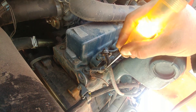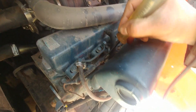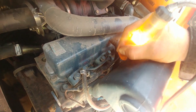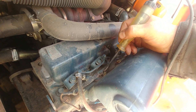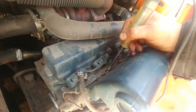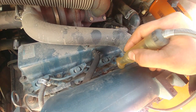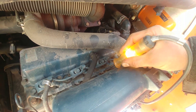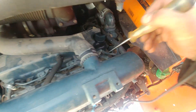A bright glowing yellow light means electricity can flow and the glow plug is good. This one is good — not open. Going to the second one — good too. If you touch it and there's no light or the light is really dim, that means increased resistance on the glow plug. You can test resistance more precisely, but if you need a quick test, this is the easiest one you can perform. Number three — glowing hot, good.